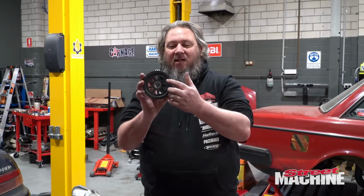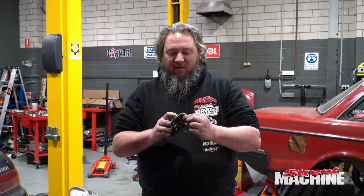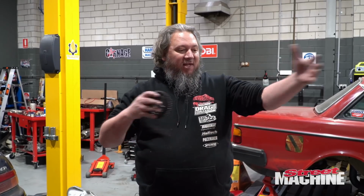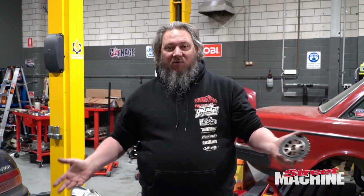So while I'm hooking everything up, I just remembered something that came up in the comment section of the last video, and that is the fact that I didn't use the cam sensor in the timing gear. A few people were a bit surprised to see I didn't put it in there. That's because we don't require it, not in this car. The VN doesn't run a cam sync, okay? So it doesn't require it because the VN is batch fire injection. The VX that we pulled the engine out of was sequential fire.